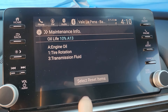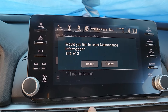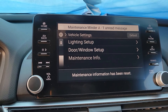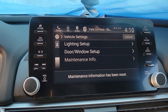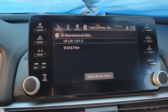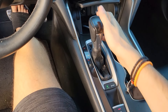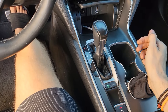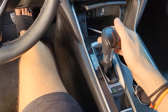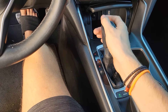I had several services due on this car, so I'm resetting it for my engine oil and my transmission fluid as well. We want to cycle through the gears around 3 to 5 seconds per gear, up and down. It looks a bit accelerated here because I fast forwarded the video, but you want to make sure that you can hear and feel the gears engaging.